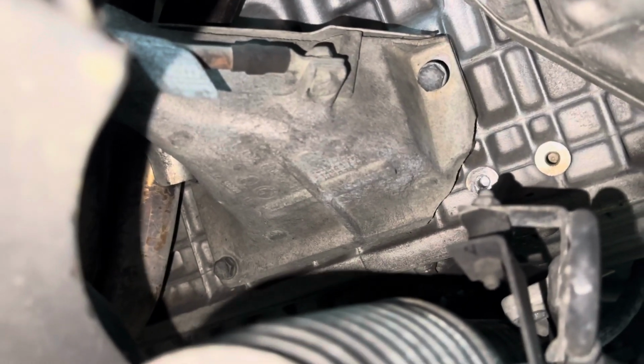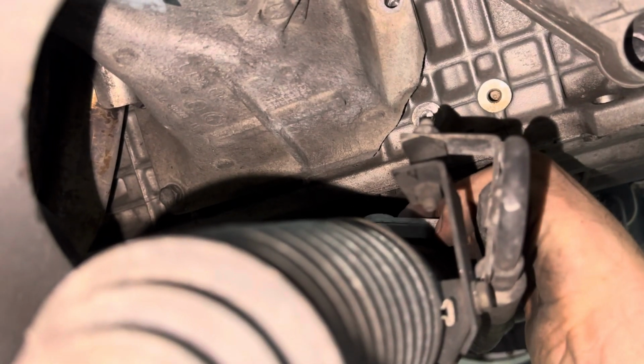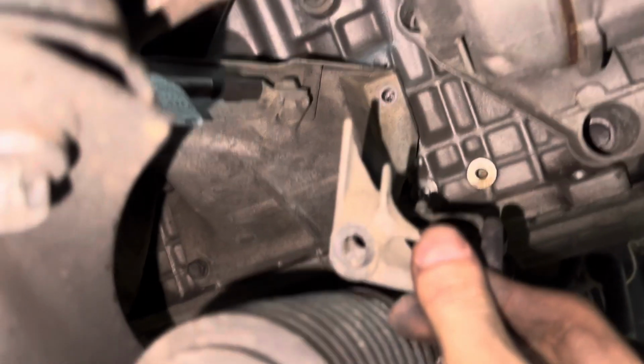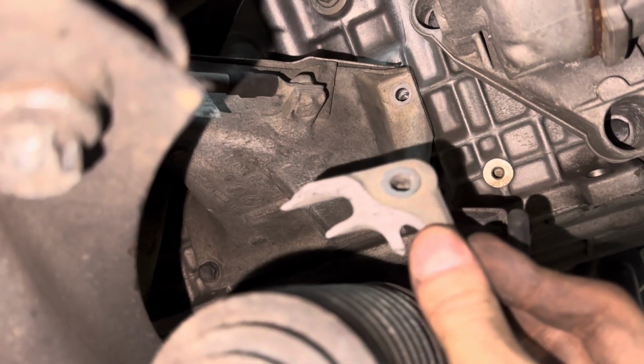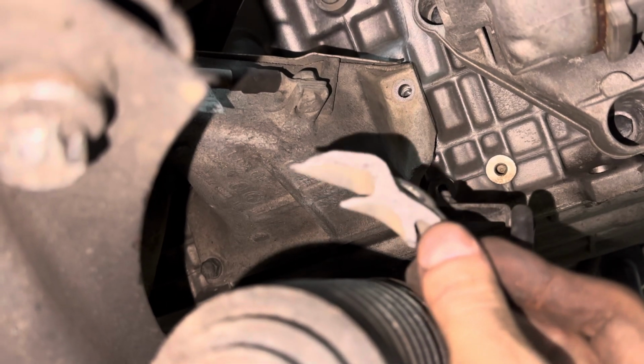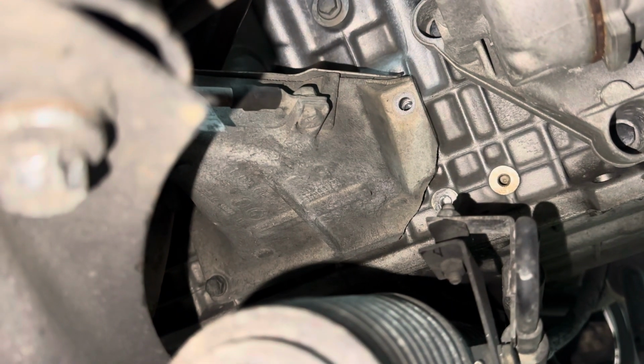I just took this engine mount bolt out the top and the bottom. When I removed the bottom one though, I've heard of this being a thing, but I've never had one do it. That is a first. So check your mounts or get the turbo one. It's not cast aluminum. So yeah, I've never actually witnessed that. That's a first. So to show you, we are floating out of the subframe there.